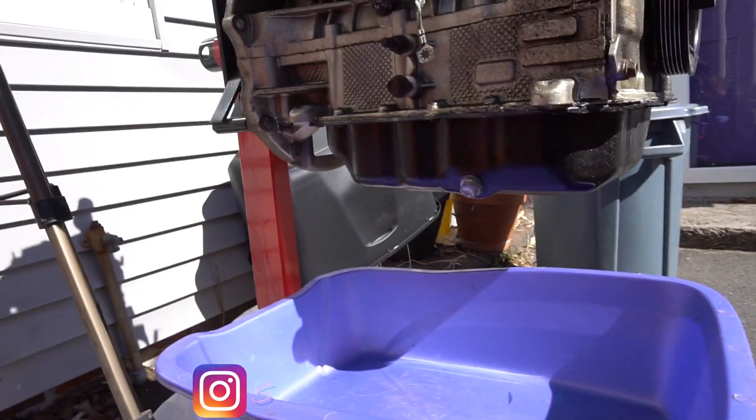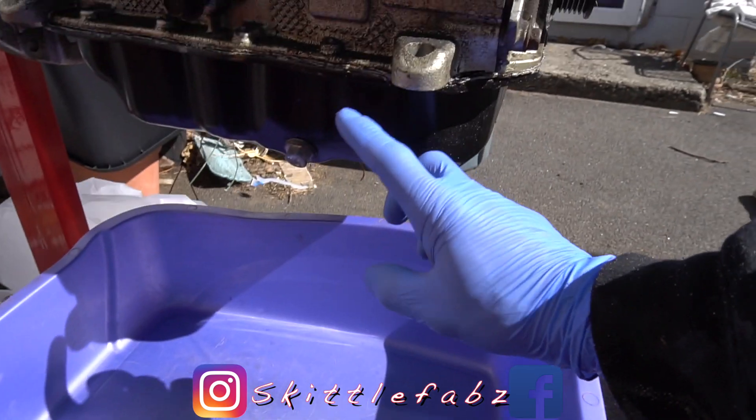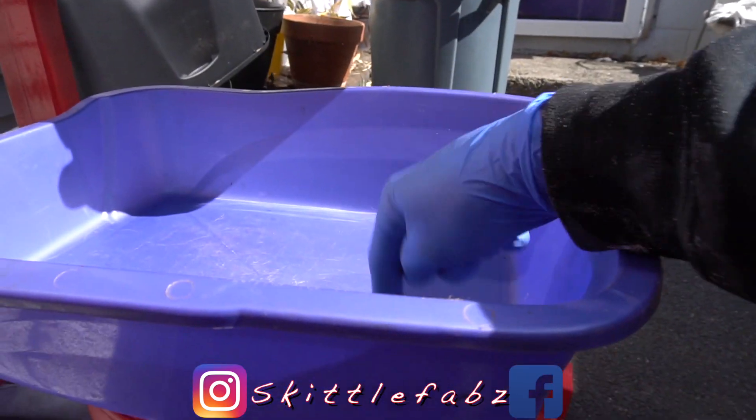Alright, this is our next step. All we got to do is loosen the oil pan bolt, let half of the oil drain into this bucket so I can still look down into it, see if there's any metal material. Then I'll be able to put the oil pan bolt back in, that way I can have a little bit of oil still in there. And if there is any big material, it'll be at the bottom of the oil pan, like right down here. I'm not trying to drain it all because it goes down at a slant. Then I'm going to go ahead and take out all my bolts around the oil pan.